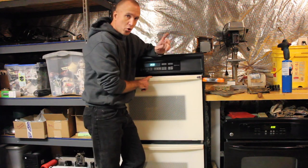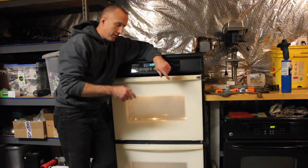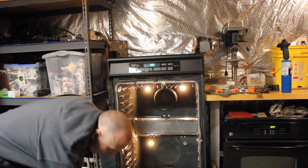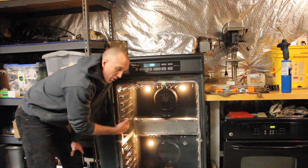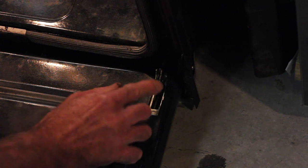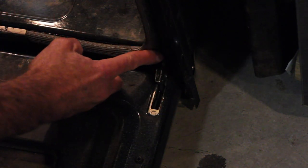Let's start with the internal parts. The first thing you're going to want to do is take off your doors. On each one of the doors there is a lower hinge point. There's a little bracket up here that you need to flip out fully extended, then close the door back up. What will happen is this gets locked in, and then you can pull the door out because it pushes the joint out from underneath this inner support piece.